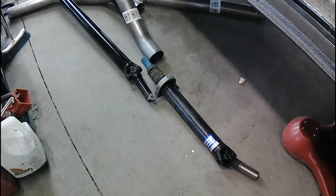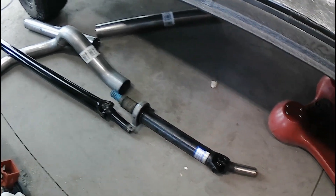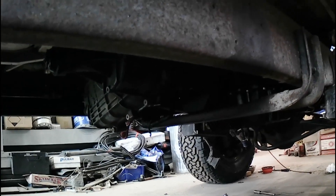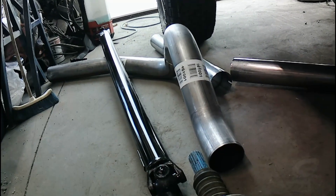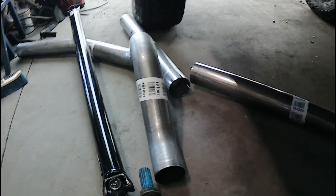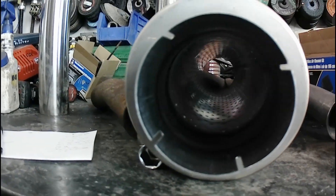Since I'm running out of parts I can't get my hands on this long weekend, I'm going to throw the drive shaft in. Underneath here, I've got the fuel tank in and everything, so I can start building out from that. To get the exhaust and everything sorted, I can put the transmission and transfer case skid pan on. Waiting for parts to do the downpipe, and the rest of the Diamond Eye kit plus the muffler on the table — it's a PowerStroke kit. I can't really start piecing it together until I get the downpipe done. Building some stuff here with stainless and working on the exhaust.